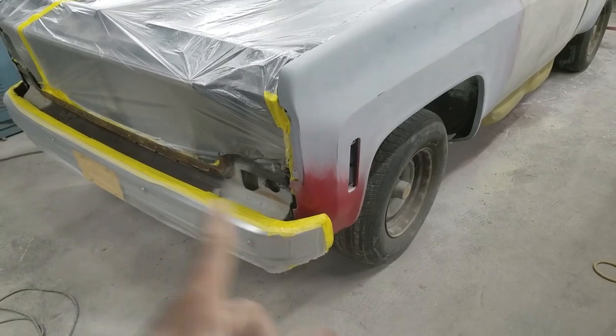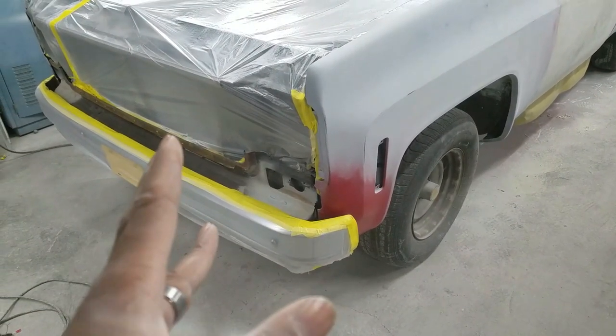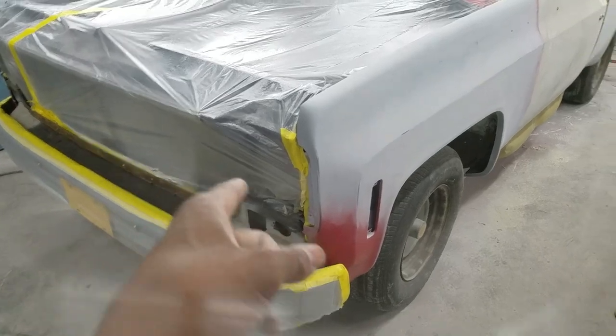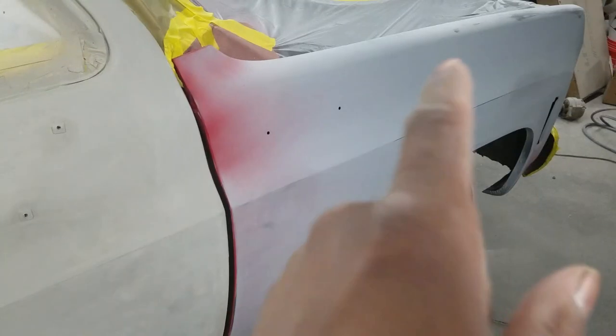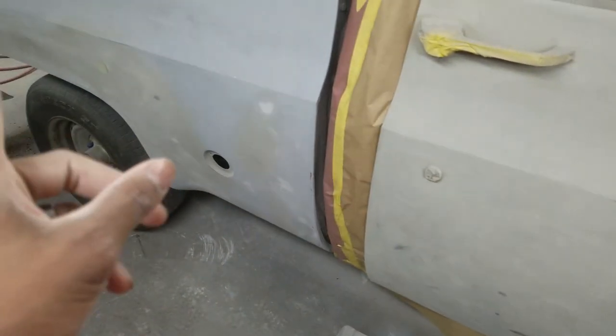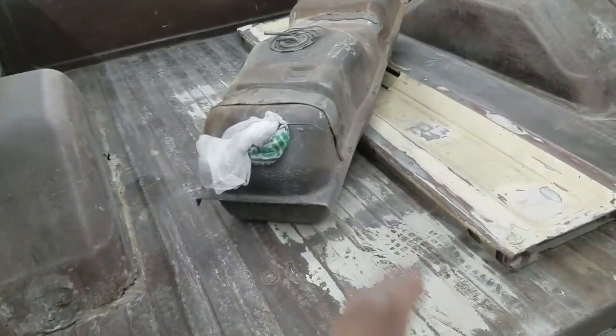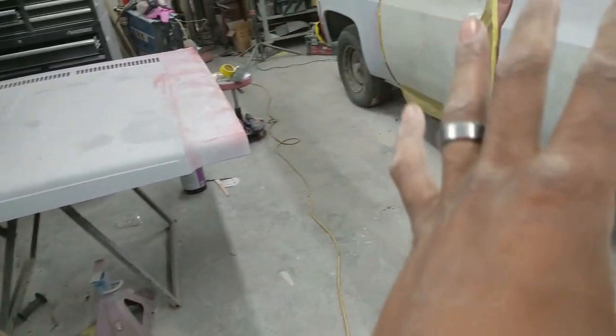I got the bumper wrapped up - I was going to take it off and changed my mind. I probably need to seal the areas here that are vastly different in color. I'll hit the spots on the doors that are light and basically anything that's not gray. I'll seal both doors, then flow coat the fenders and the bed where I've got my light gray to get everything a grayish color. The tailgate I'm going to do separate because I just did not have space to work the tailgate and the doors and the hood and the fenders all inside the shop. The truck and hood should get done and I think I've got a gallon of base coat so I should have enough for the tailgate.